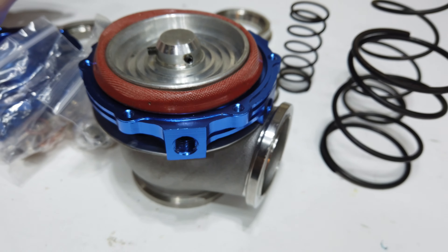I paid roughly £90 for this. I'll be contacting the seller and saying: the valve's apart, there's swarf in it, the valve was seized, and I want my money back. With blow-off valves you can get away with something a bit cheaper, but with wastegates definitely not. I've just ordered a TurboSmart 44 or 45mm version - it costs a lot more money but at least I can fit it and the job's done without worrying about it. Hope you've enjoyed this video - make sure you like and subscribe for more.